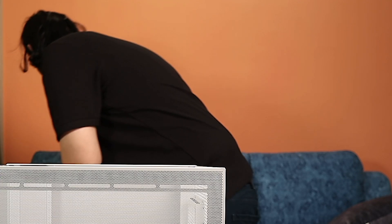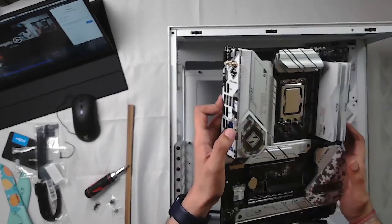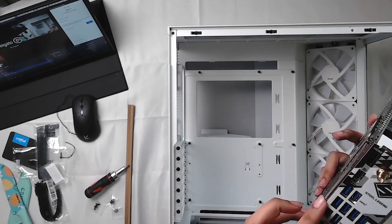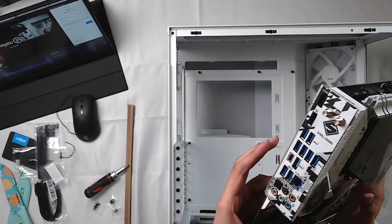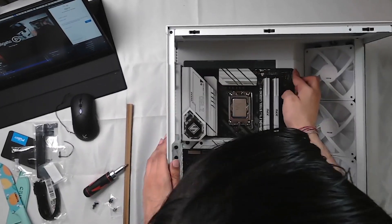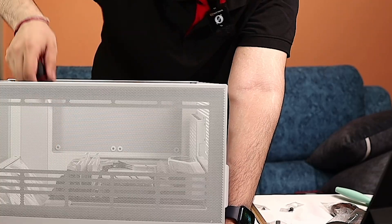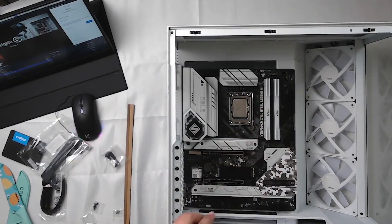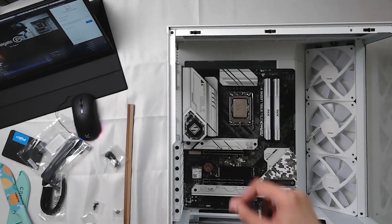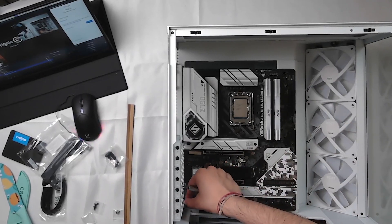There are many alignment options. The back plate is already pre-installed, so you don't need to worry about the back plate. We have to push the motherboard into position, then seat it properly. Tighten screws in a cross pattern — top, then other side — so that the tension is equal across the board. Then fix any remaining screws.